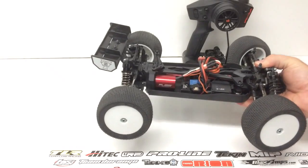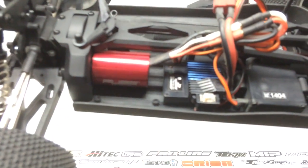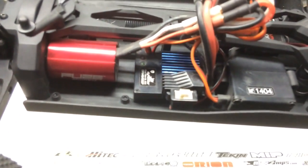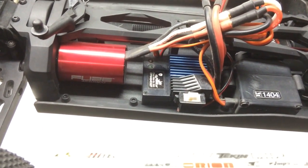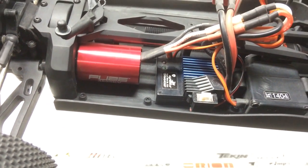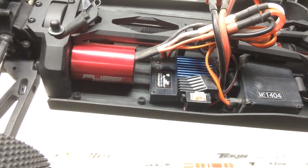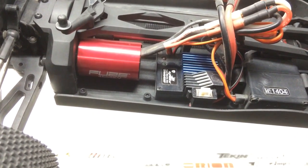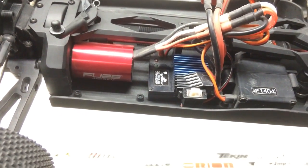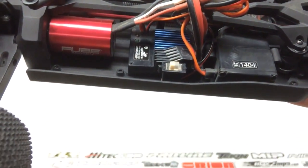Now, like I said, the AVC is built into the actual ESC here. And the ESC did fine. I had no issues with the ESC. I ran it on both the stock nickel metal hydride, and I ran it on a 2S LiPo and a 3S LiPo. And temps were absolutely perfect. It got up to about 170, 180, maybe on the high side of things, but considering the size of this thing, no issues whatsoever. Little waterproof switch here. All was good with that.